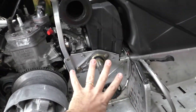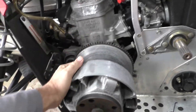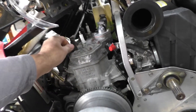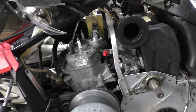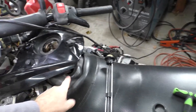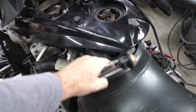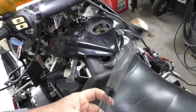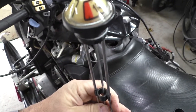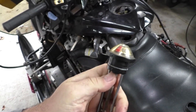I took off the secondary clutch — that's getting cleaned up. This is your primary clutch, and it feels really good. I put new spark plugs in because those were really beat up, and power-washed everything. The reason I have all of this taken apart is because the fuel gauge, which drops down into this hole right here, will stick and won't work.